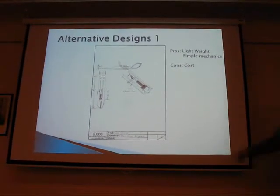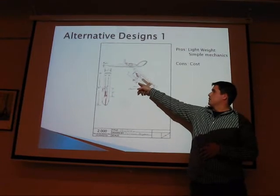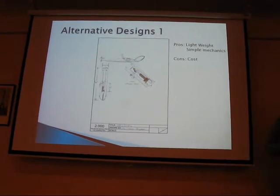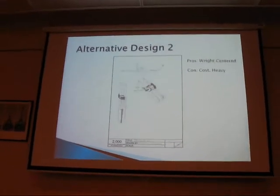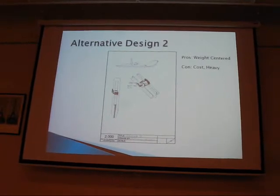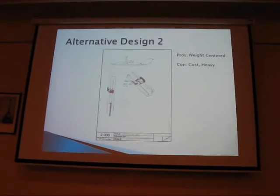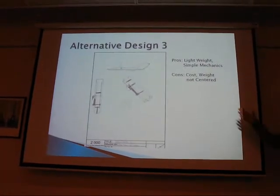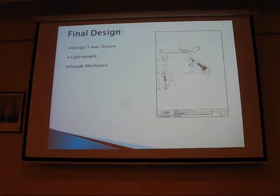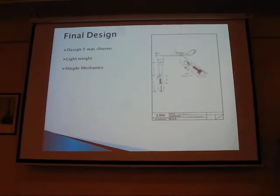The first design used a linear actuator at the center of the ski that pulls back and rotates a shaft that lowers the wheels. The cost was a problem because the linear actuator cost a little more, but it was lightweight with simple mechanics. The second design used a winch motor to rotate the lower wheel, which is common, but the winch motor cost a lot. The third design is similar to the first, except it was mounted on the outside of the ski, which simplifies the mechanics. The final design I picked was the first design, mostly because of simple mechanics and easy assembly to different types of snowmobiles.